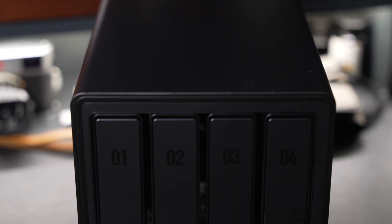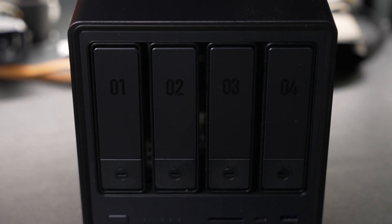I actually used to run a computer service business, and back then NAS or network attached storage was mostly something you'd only see in enterprise setups. For home use, this is actually my first time building a dedicated NAS. Until now my setup has been pretty basic — a single 16TB external hard drive connected to an older i7 Mac mini. That one drive has been doing everything: Time Machine backups for two computers, acting as a general file server, Plex for movies, my kids' soccer games, and my YouTube projects. But it has some major drawbacks. The drive goes to sleep and I get delays every time I try to access it. The i7 Mac mini really struggles with real-time 4K transcoding, and worst of all, there's no redundancy — so if the drive fails, I lose everything.